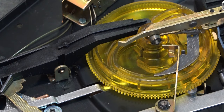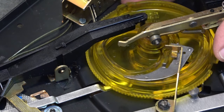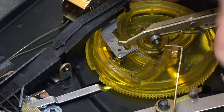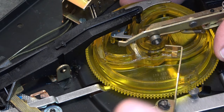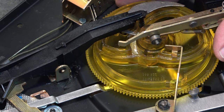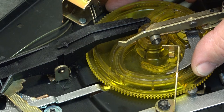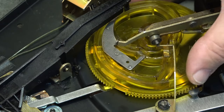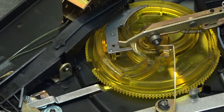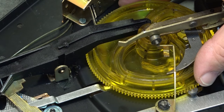If kicked toward start, this lever pulls the cam over and causes the cam to follow the inner movement, which actually pulls the tonearm over towards the record, stopping it mechanically at either the 12 or 7-inch position depending on what record is playing. That brings the arm in and drops it. If pushed in the opposite direction to stop the play, it doesn't operate this cam lever, so the process instead lifts the tonearm and moves it back to the resting position, then drops the arm.